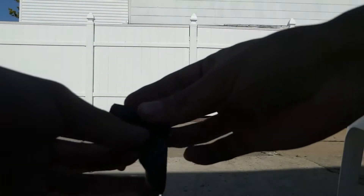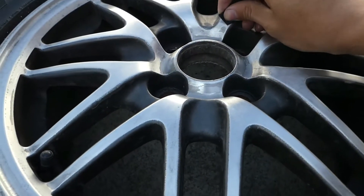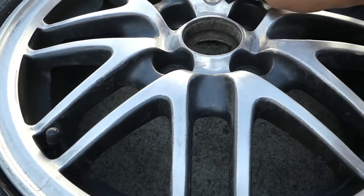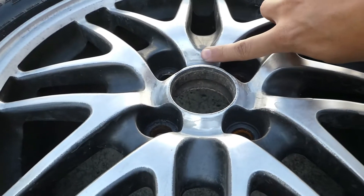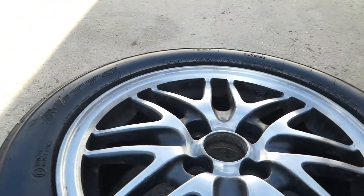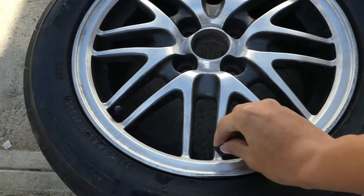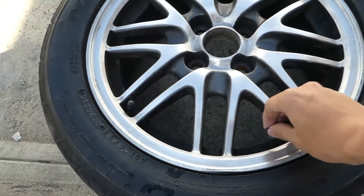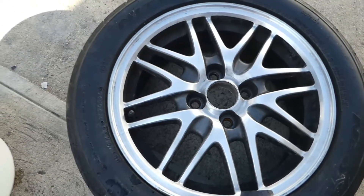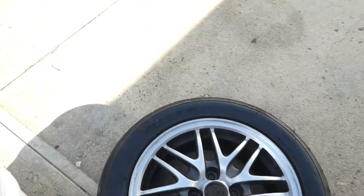You're going to want to get your sandpaper and make sure you wet it. To get that old clear coat off, you're going to want to dig into it and it'll start popping right off — just angle your sandpaper to get that off. Another thing: you're going to want a chair because you want to get comfortable. You're going to be here for a while sanding it down — it's a long process, but we're getting there. So I'm going to run it through with 1000 grit, then 1500, and then polishing.